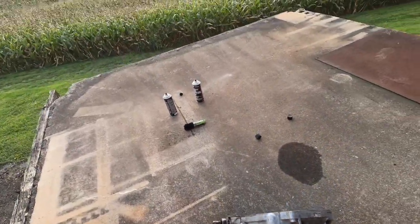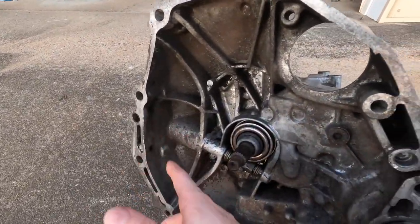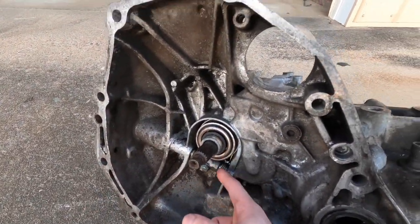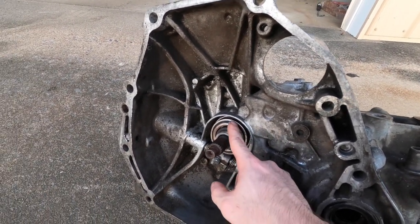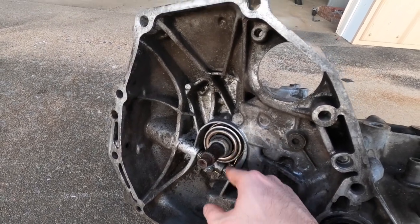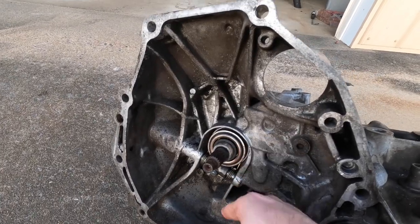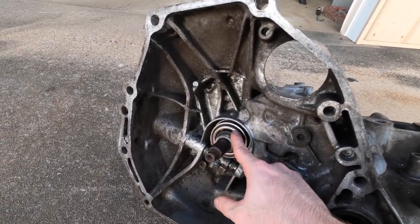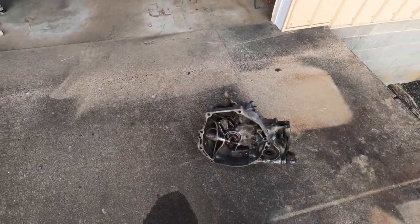That's fantastic. I'm going to take off the clutch lever. Well, not the lever, but the throwout bearing. Grease the shaft, grease the bearing, because I gotta clean that out. It sounds gross. I think it's because I brake cleaned it. So I'd probably have to get one before I put this in, but it was fine before I brake cleaned it. I'll have to check that out, but I'm gonna pull this apart now and grease that.